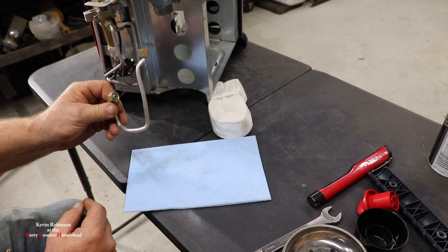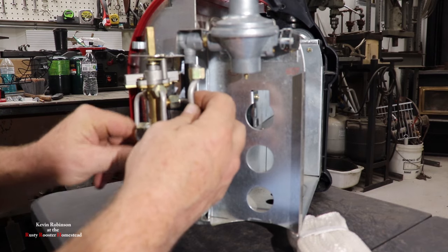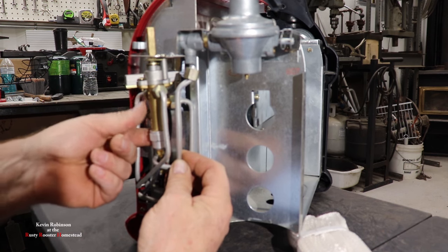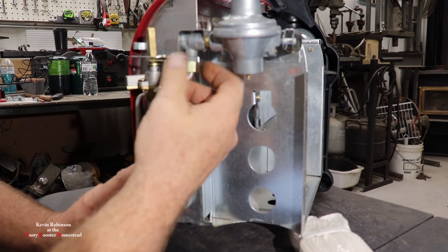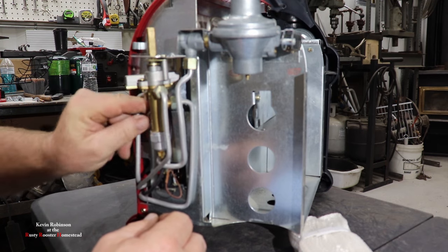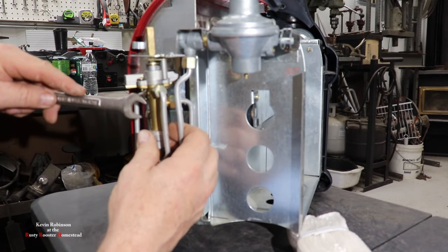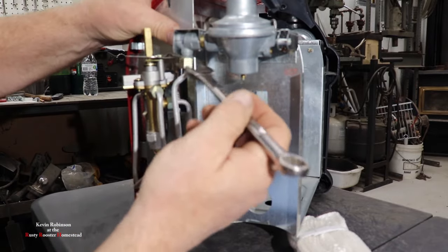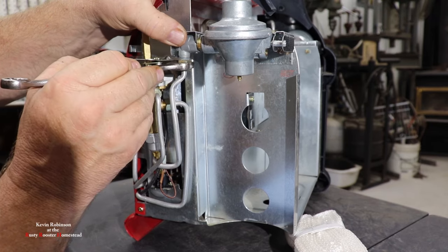Now we've got to get this thing put back on. We're going to put it back together the same way we took it apart. Slide this guy right up inside of here, and then the other one goes around the side. I'm going to mount the back one on first, and I'm not going to tighten it all the way up — I'll get the other one started and finger-tight both of them first. Once I have them both finger-tight, we'll get the 14mm wrench. When we tighten this up, we're not going to go crazy — just snug it. We don't want to break things in here.